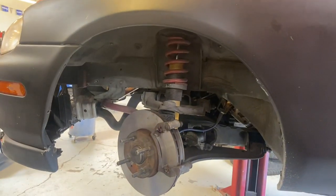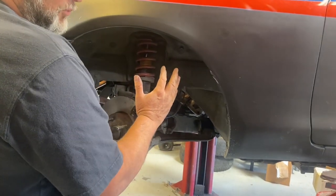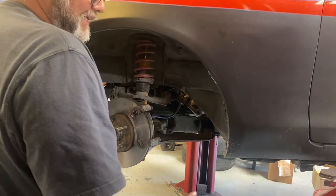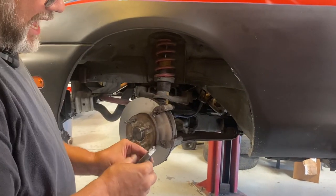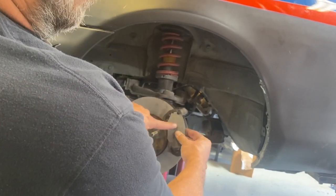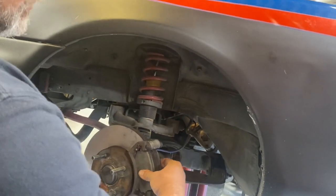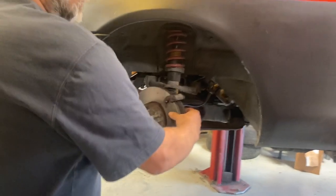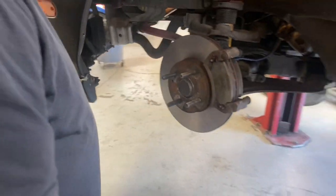I got those tightened up - I'm going to give them a good tightening. They're probably torqued to about 40 pounds or so. Definitely don't want those falling off - I've seen when the top one falls off, the caliper falls back and gets wedged between the rim and the car stops dead cold. So now I'm going to take the new pad. Notice the roundness of the rotor and the pad - don't put it on backwards. This surface right here is the brake lining - I want to make sure it's faced in the right direction. See how easy it is to put the pad in? Both pads are in there, fitting flush against the rotor, no gaps.